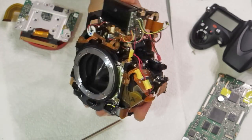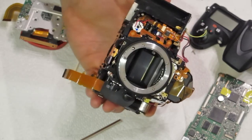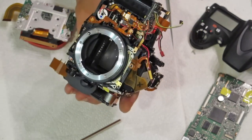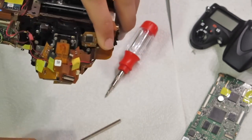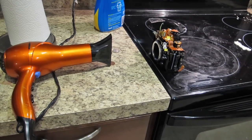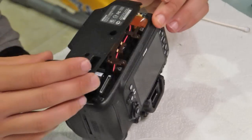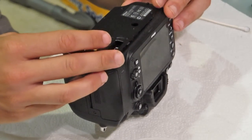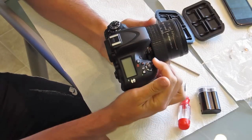With the whole camera disassembled, I made sure all the parts sat out for a while to dry. For larger parts like the back containing the LCD and viewfinder, I used a hair dryer on a low setting for several minutes to drive out any remaining moisture. Once everything was dry I reassembled the camera, simply reversing the steps already covered, and put the last panel back on.